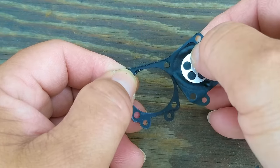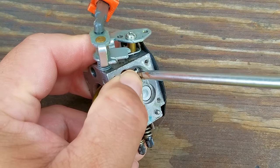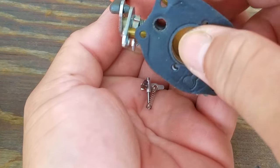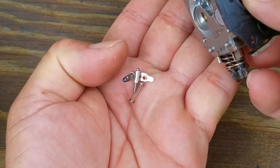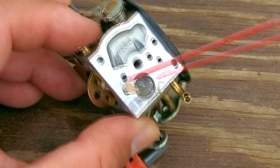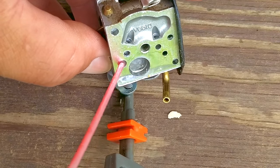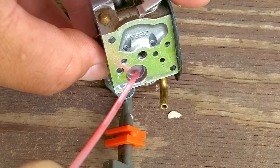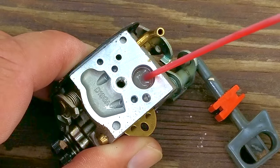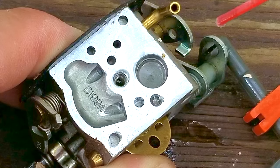We need to be extremely cautious when removing the bolt that holds the rocker arm assembly to the carb. After that, we can carefully remove the needle, rocker arm, and the spring. Once you've gotten these tiny parts out of the carb, you'll need to carefully put them somewhere where you won't lose them. After that, we can safely use either brake cleaner or carb cleaner on the screen. While spraying the screen, watch to see if the cleaner passes through it. If it isn't able to pass through, keep spraying until it does. If it still won't pass through, fill the pocket with cleaner and let it soak repeatedly until it does.